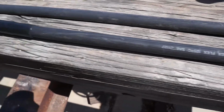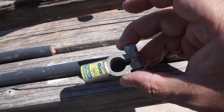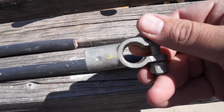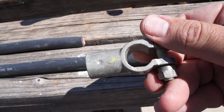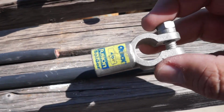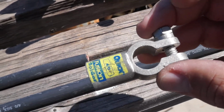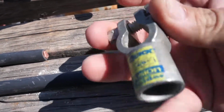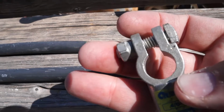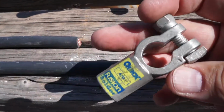I'm sure some of you that have done this before will find this boring, but any of these terminal ends are basically conical shaped. As you'll see, if this will pick it up, this is wider than this. The reason being is the posts are sort of cone shaped. They're bigger at the base, smaller at the top. And if you'll also look, if this shows it, come on, focus, right there, it's a little minus or dash. This is a negative terminal.